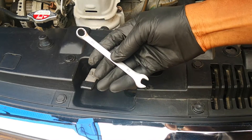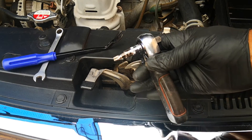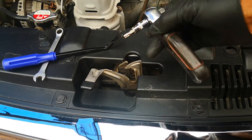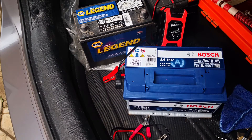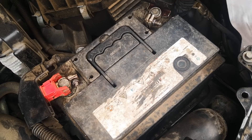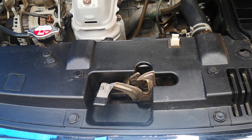Tools you're going to need: a size 10 wrench for taking out the negative terminal of the battery, a clip removal tool, and a T30 Torx wrench — the sensors are held by T30 Torx screws. The first thing you want to do is to disable the SRS system, and to do that, you disconnect the negative terminal of the battery. Allow it to stay for at least three minutes. Negative terminal off. Let's get to the crash sensors and replace them.